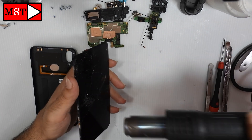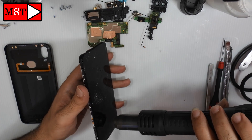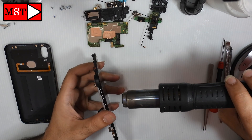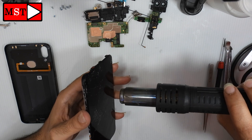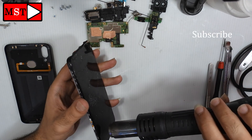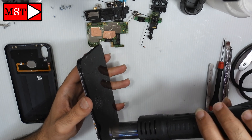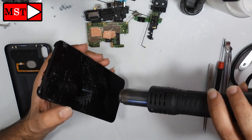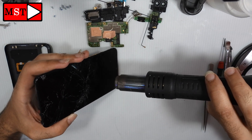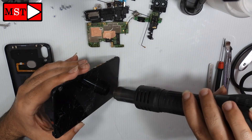It's better to remove the battery first because the screen flex cable is under it. If you remove the screen now, you won't be able to remove the flex cable — you will cut it. So if your screen is working, you need to remove the battery first. In my case the screen is damaged and smashed and needs to be replaced in the next video.